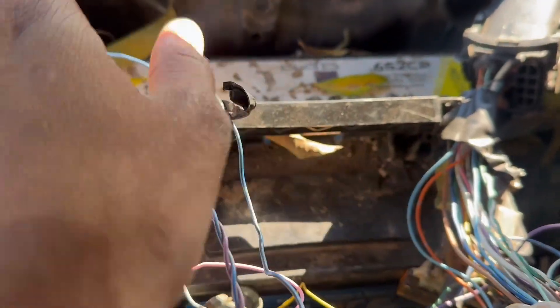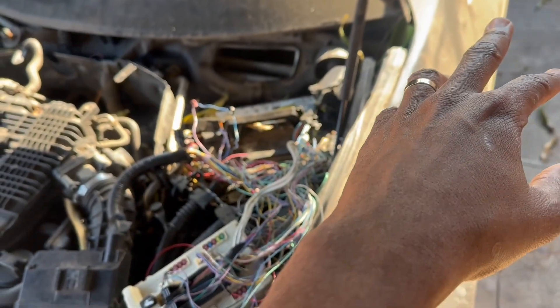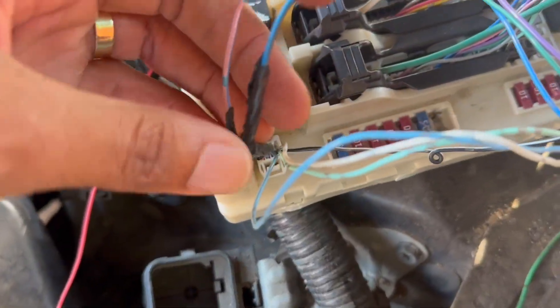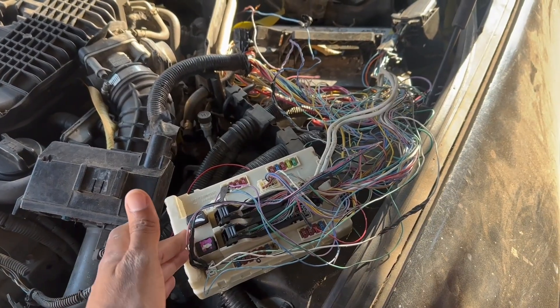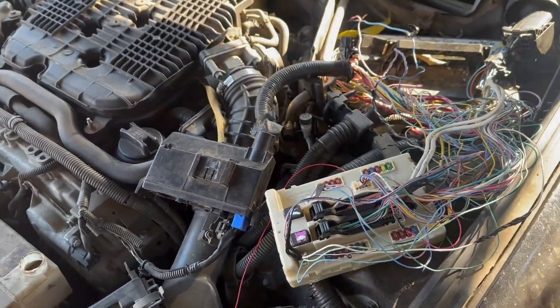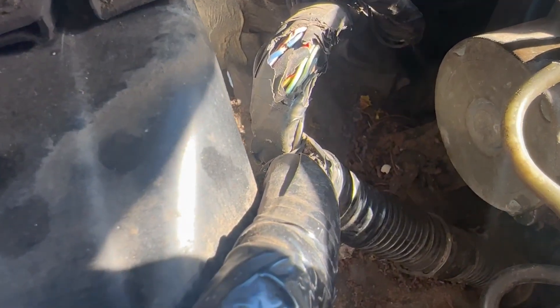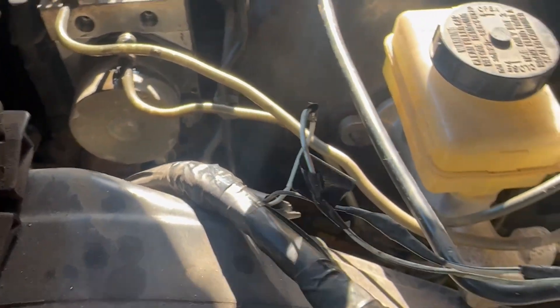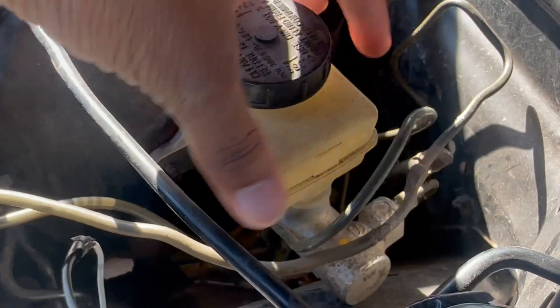At this point I was doing a visual inspection. You can see this wiring had been tampered with before — this car had been at two shops already trying to fix it, and someone had already attempted to test the CAN line. The CAN lines are those blue and pink wires from that connector, which travel through a main line that goes behind the firewall and connects to the ABS on the other side. I also noticed some wires had been chipped — I believe that was caused by rats during the time the vehicle was stopped. I thought it was a good idea to remove the brake booster to check for any broken wires behind it.